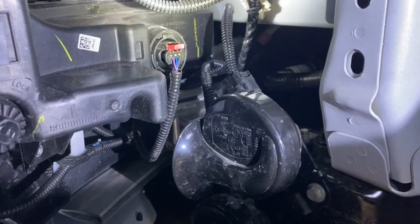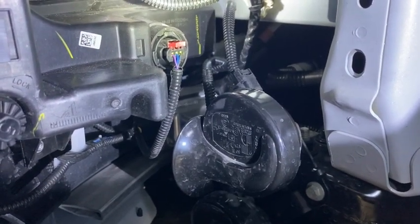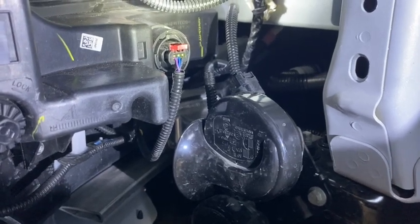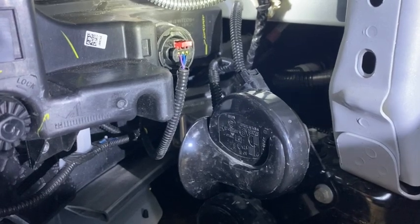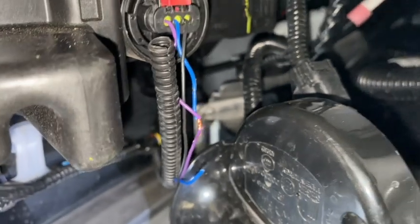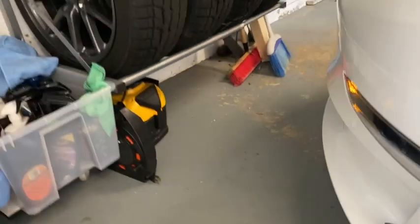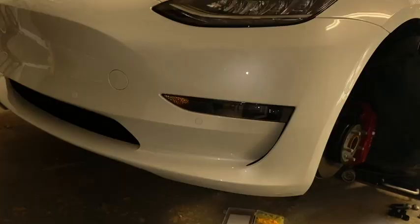The problem is there's no switch, so if you connect it, it's always on when the lights are on - it only works at nighttime, not during the day. You could run a switch to it and have it inside the car; there are definitely ways to do it. But for now we're just going to connect it without a switch and see what happens. So I connected the blue wire and the purple wire together so the blue fog light wire can get 12 volts. Samuel, press the brake - and there we go!